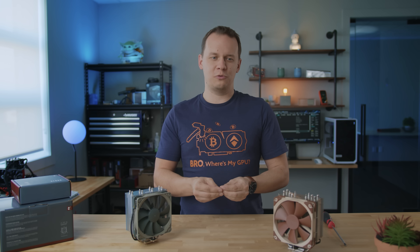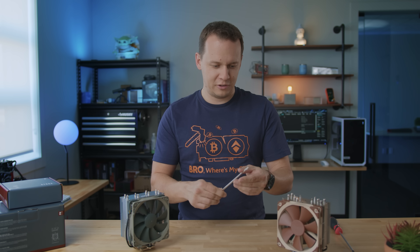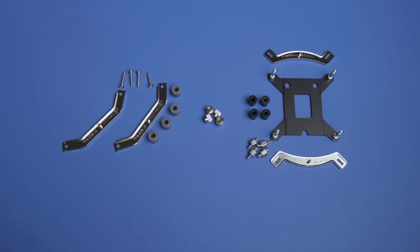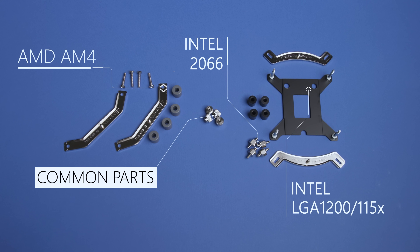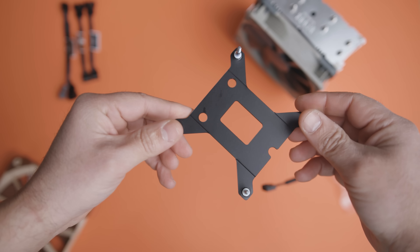I also want to talk about the installation hardware, because it's the one thing I wish Noctua would have added to the Redux — that really handy screwdriver you get with almost every other Noctua cooler. Noctua includes your standard AM4 mounts, but there's no AM3 compatibility; for AM4 you reuse the backplate that comes with the motherboard. On the Intel side, you get LGA 1200 and LGA 1150 hardware along with 2066 studs. And I have to give it to Noctua because they're using a full metal backplate for the installation of Intel systems.